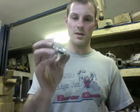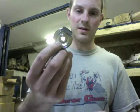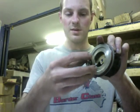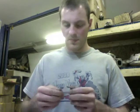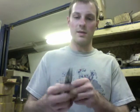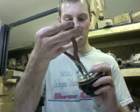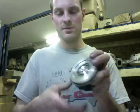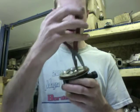Make sure this oil deflector is completely in the hole, because if it's not centered it can lock up when you go to tighten the nut down. Insert the oil deflector into the open area and compress it down. If you have a hard time getting it in, you can press it in with a socket. Then install your C-clip — I just use a pair of pliers I got from Walmart and ground them down. Be careful because it can really hurt you if it flies off, so I usually put my finger here to stabilize it.